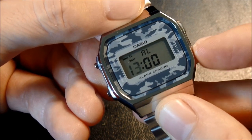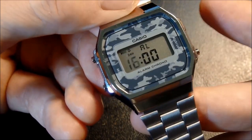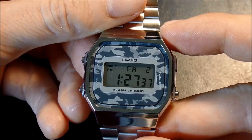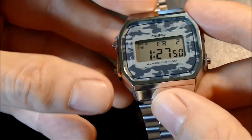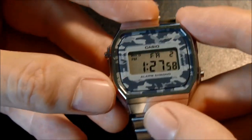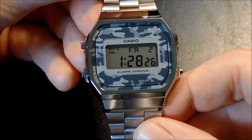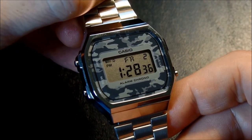For the afternoon hours: 1300, 1400 hours which is 2 PM, and so on. I'm going to set it back to 1600 hours, which is 4 PM. To use the nightlight feature — Casio calls this an Electroluminescent Light, or EL for short — that's the top left button; press and hold. Lastly, to view the month, it requires a 6-button press: mode, mode, mode, light, light, light — or down, down, down, up, up, up, which is easier to remember. From main timekeeping: mode, mode, mode, light, light, light, and there it displays the month. To get out, just press mode once. And there you have it — that's everything to do with the Casio A168.